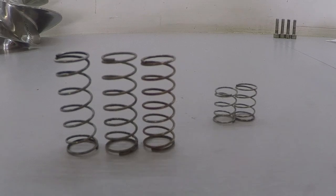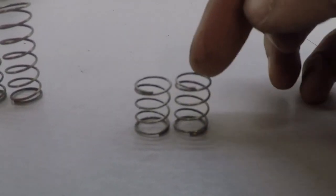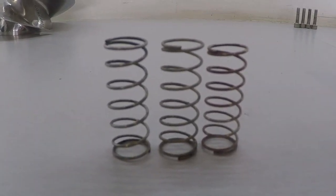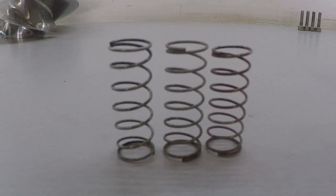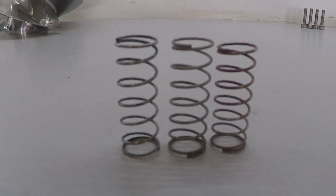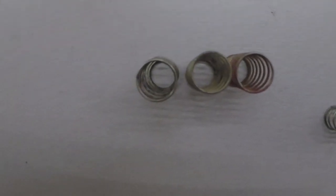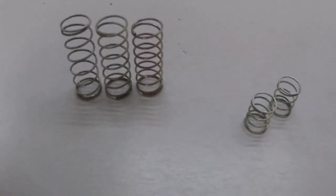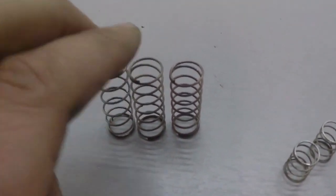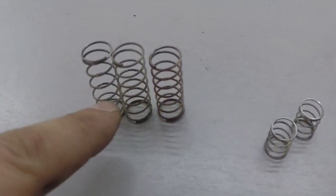We have two sets of springs in the 951 RAVEs — you can see these are two different sizes, so you want to keep that consistent. Of these ones here, the two on the left are actually the same size and the one on the right is a little bit smaller. The one on the far left looks different from the middle one but they actually are the same — the difference is that one is bent. What you want to do is just keep everything consistent. Ideally use two the same size, but because one's bent I'm going to replace it, otherwise we'll have different spring pressures.